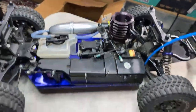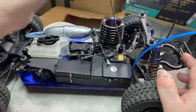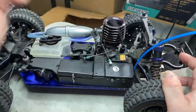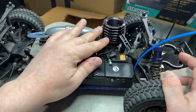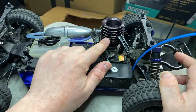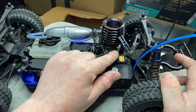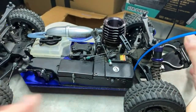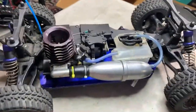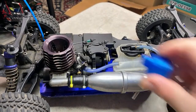Since the pull start is the current issue, we have to get to the engine assembly, maybe clean it. These systems are coil off-crank — I think they're called like the HPI system, coil off-crank. Technically the one-way bearing isn't like a regular one-way bearing. I guess we're gonna have to dig into it. I wouldn't mind 3D printing a filter housing for this right now, but I'd have to do a filament swap.